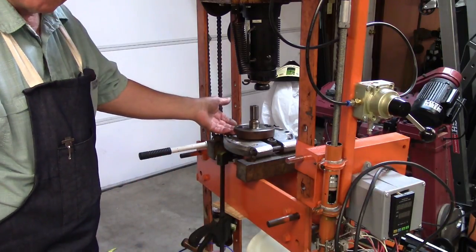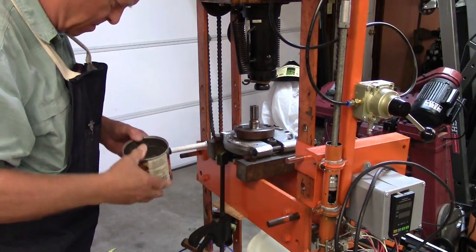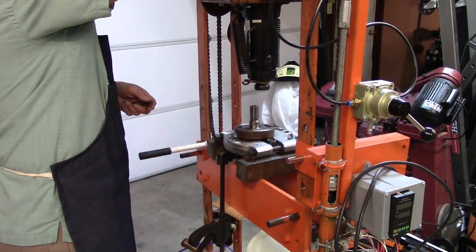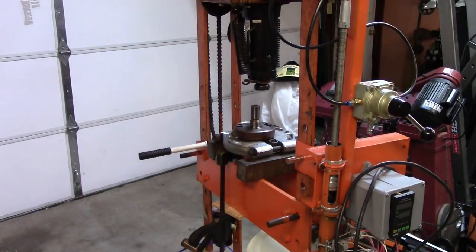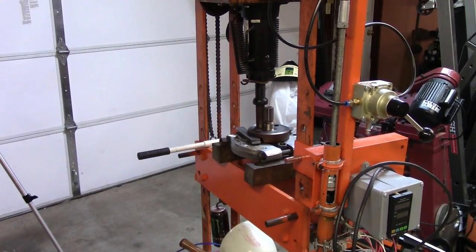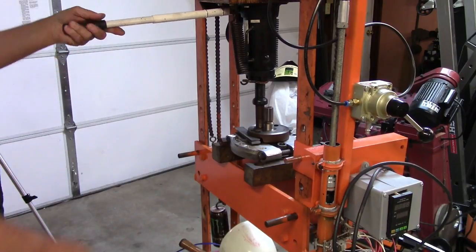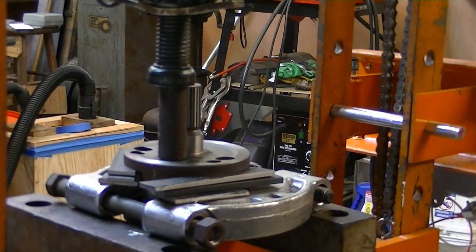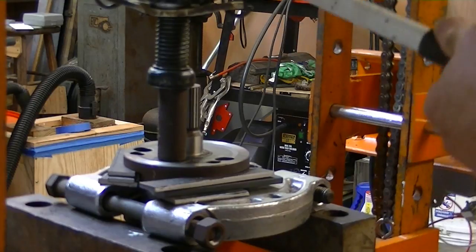I'm going to have to find something to shim up under this side of the crankshaft — that's an unexpected thing. I've shimmed up under the thin side here and we'll find out if my 10-ton press is still able to handle a motorcycle crankshaft. There was only one I ever couldn't do — it was one I got together and couldn't get back apart again on a Bultaco, and I had to go to a guy that had a 30-ton press to get the thing apart.